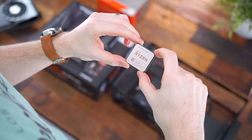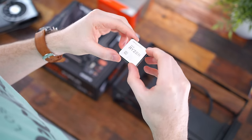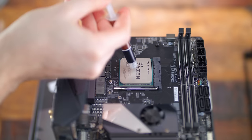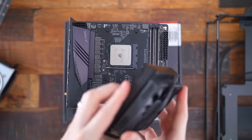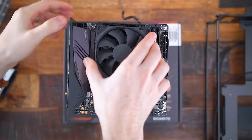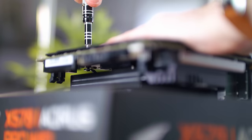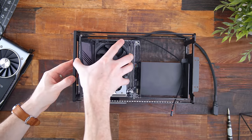The 3950X is a 16-core, 32-thread beast at 4.7 GHz unlocked — great for gaming, video editing and more. Since we are limited with space in a case like this, you can use an air cooler up to 51 millimeters tall. I went with the Noctua NH-L9A Chromax cooler, their newer all-black model. You can technically fit certain AIO models like the Corsair H55 and the NZXT Kraken M22, but check the requirements on the site because you're limited in terms of space with some radiators.